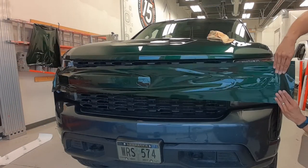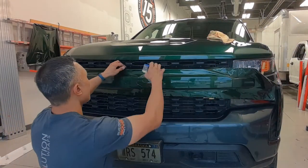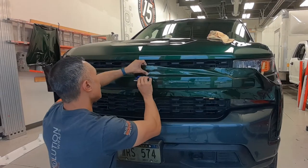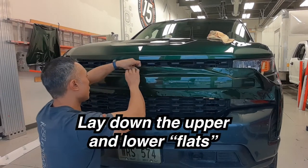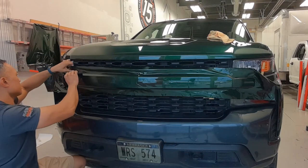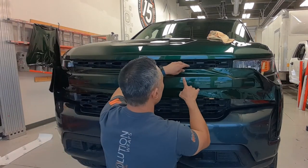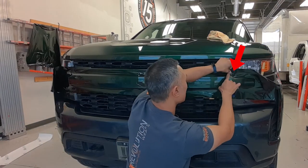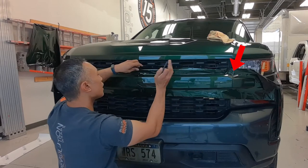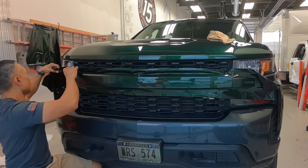On the tops and bottoms the vinyl just falls right in. I do the same thing on the driver side — get those horizontal wrinkles across the face, flatten out the face, and then start to lay down the upper and lower flats. I'm going all the way to where the top of the grill emblem meets the headlight area, and you can see by those red arrows where they ended up.